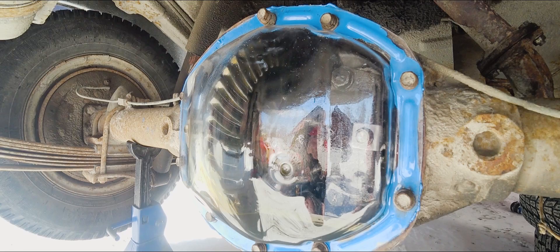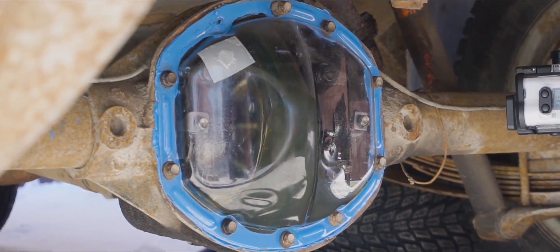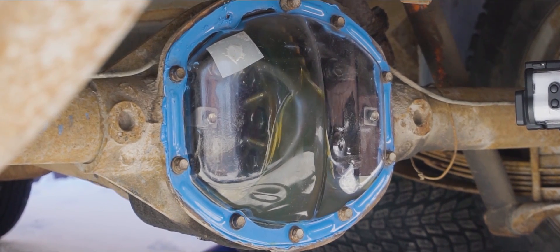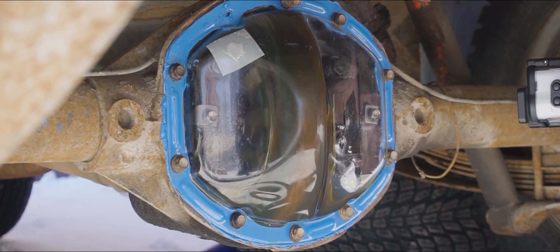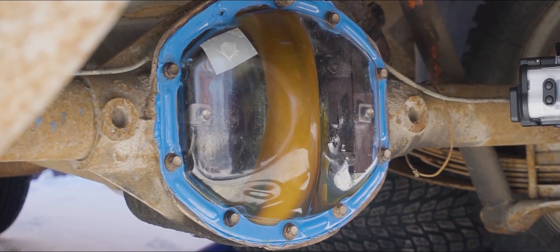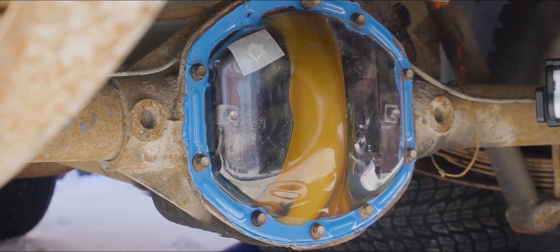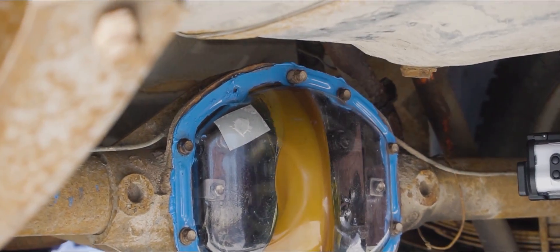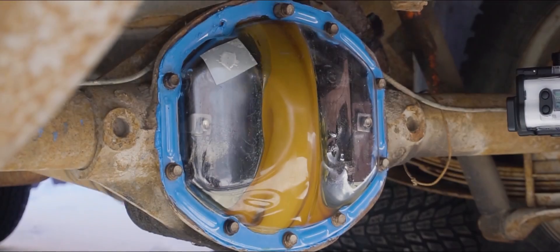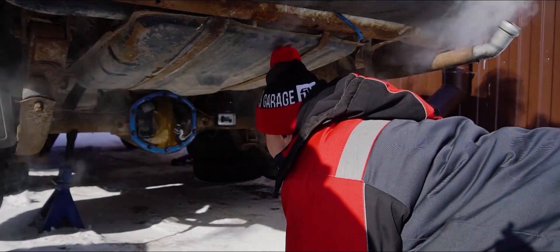Let's fire up the engine. Holy cow, look at it go. Get it into a higher gear. That mineral oil has definitely thickened — quite noticeably. Look at how it's hesitating to flow. Still, you can see it getting all whipped and how it's foaming. That thing basically works like a blender and infuses the oil with some air. There's plenty of oil making its way up, getting good coverage — the whole thing is lubricated. But if you look closely, the bearings aren't getting as much. They definitely need more than they're receiving. When the oil was liquefied, a lot more of it was splashing onto the bearings.